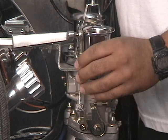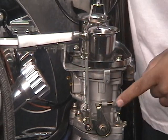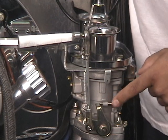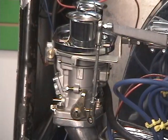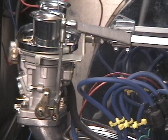We've got our jam nuts tied on the linkage rod and it's screwed back into the arm. Now we're testing to make sure they both move at exactly the same time with just a little bit of force. They're both moving — you can see both the idle stops. From this point, we're good to go. We're ready to fire it up and see how she sounds.